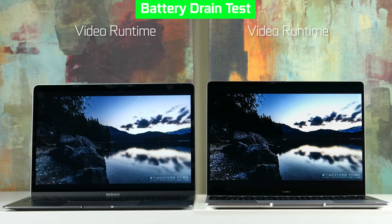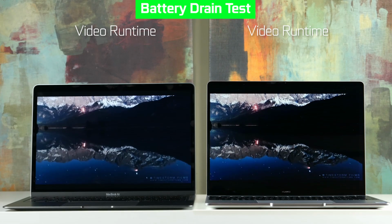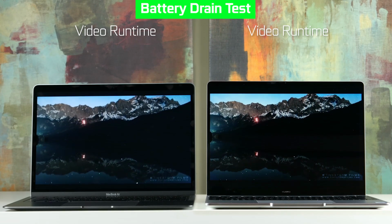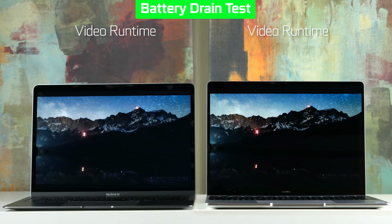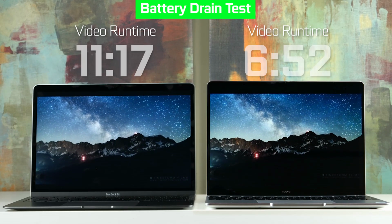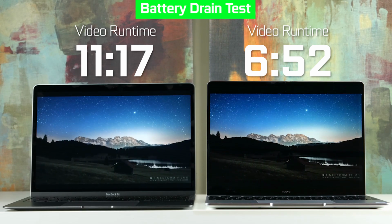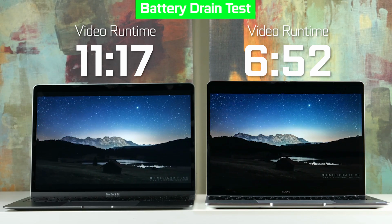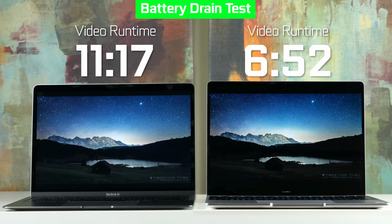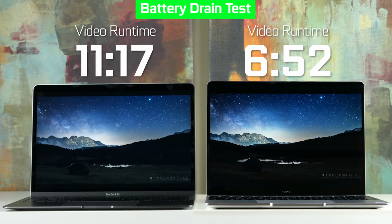Now, based on our video playback test in the exact same scenarios where we play a video on loop to infinity, put on airplane mode on both PCs, 50% screen brightness, we got about 11 hours, 17 minutes on the Air, versus the Matebook 13, after a couple of different discharge cycles, mind you, got only 6 hours and 52 minutes, which is more than 4 hours less than what the Air got.